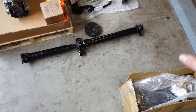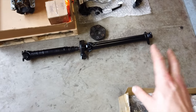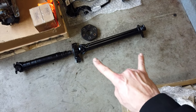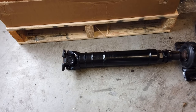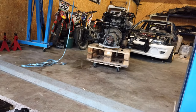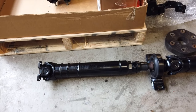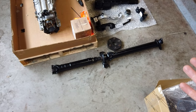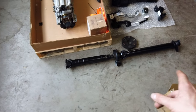Regarding the driveshaft, it comes in two pieces: the rear section corresponds to the differential and the front corresponds to the gearbox, so you need to make sure to get the correct length for whatever you're using. I'm using the big Supra differential — the 220mm — so I already had the correct rear section. My front section did not correspond to the V160 gearbox, so I had it extended by 43 millimeters, which is the approximate difference between the two transmissions. You can swap out the front section for a V160 one, but they're really hard to find. There's also the option of a single-piece driveshaft, but that's a couple of weeks' wait and more expensive. Whatever you do, make sure to get the correct length for your specific setup.